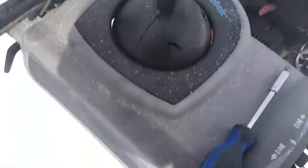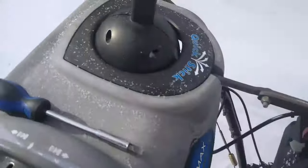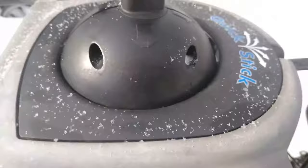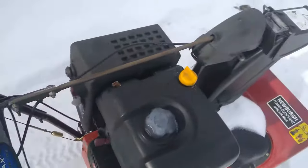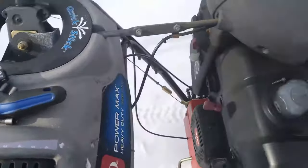What we're gonna do is — it looks like there's one bolt here, about a 10 millimeter — I'm gonna take that out, take this shield off. There are two screws on the neck here. We're gonna take this apart and see if I can grease it or something. It looks a little rusty up in here, so I'm gonna take this apart and then we'll start from there.